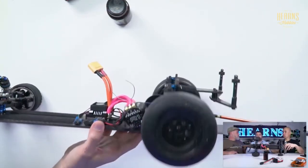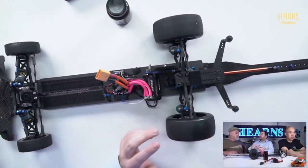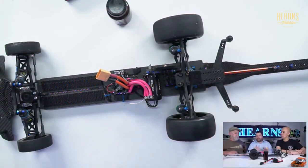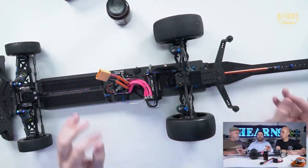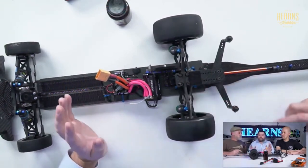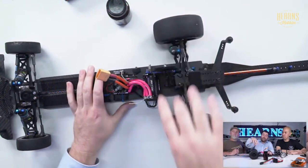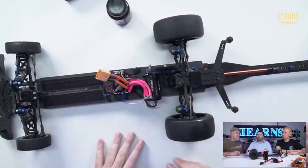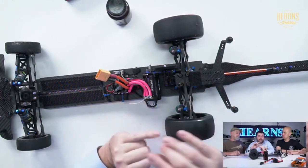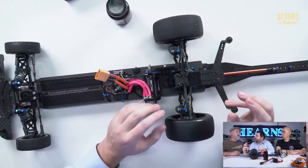What we do is multiple coats - do one coat, let it flash off, then do another coat. If you're having trouble getting your car down the line doing your pass, it's probably because you're not looking after your tires. The tires are the only thing that transfers all of this power to the road. So clean your tires after every pass. If you're using prep, use wax and grease remover from Bunnings on makeup pads - I pour some onto there and wipe my wheel.